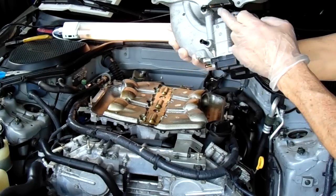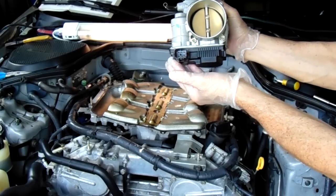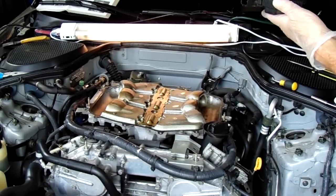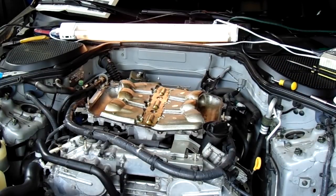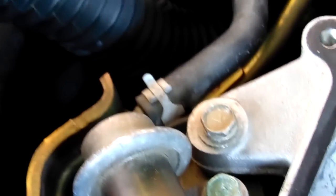It was definitely difficult to get the two coolant hoses off of the throttle body — it took quite a bit of finagling. The throttle body linkage and electrical linkage were not a problem, but I had to use some 303 rubber spray to soften up the rubber and break it loose. There are a few more bolts on both sides that attach the electrical engine harness to the plenum just to keep it secure — you'll have to disconnect those.